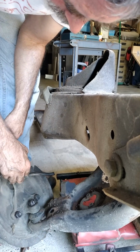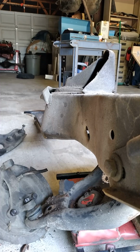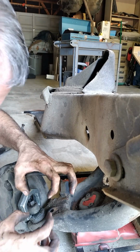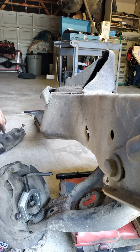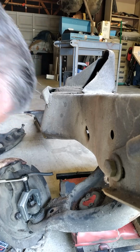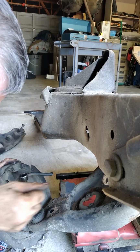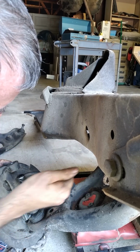Now I will take this lower off. So I'm going to pause it for a second. All right, I'm having the same issues as before, where this puller, the little fingers are too far apart in order to grip onto the arm. So I'm just trying different methods here. I left the nut on there and have a little grip that the puller can sit on, and then pushed it back more towards the wheel.